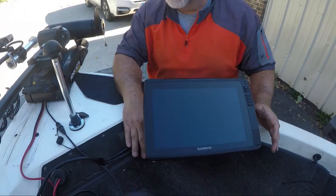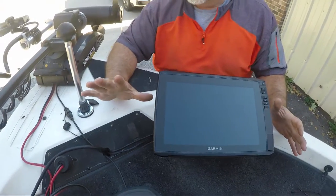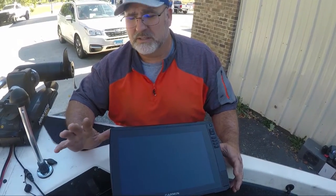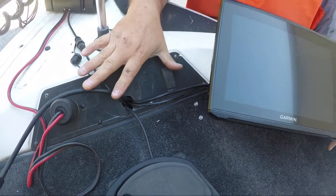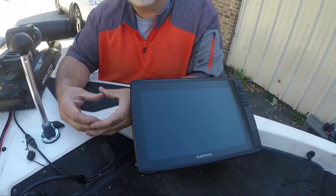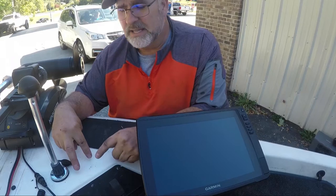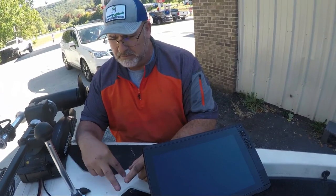Up here we've got the power on in the back, the unit in, and the black box completely installed — everything looks clean. There was a hole the customer had put in previously, and I adapted it by running all the wires through there so it looks like nothing was ever added. Behind here, my new drop circuit comes from the back all the way to the front, feeding a power distribution bus with four ports. The first port is the wire from the back, then there's a red and black, then a power wire for the unit and a power wire for the GLS 10 box — red to red, black to black — with one expansion port remaining for a second unit or sounder.